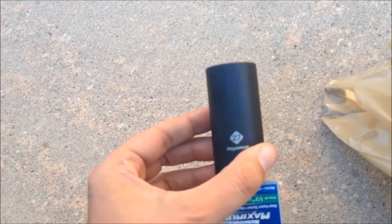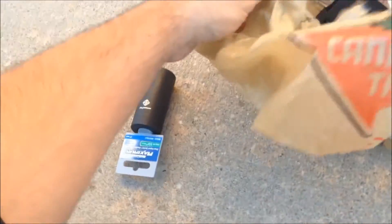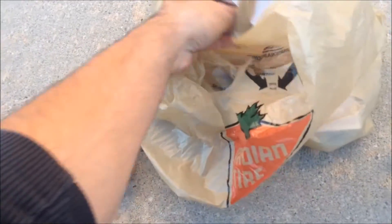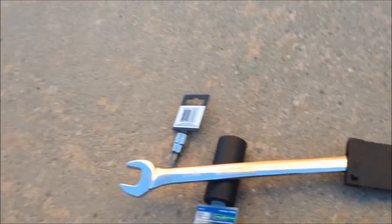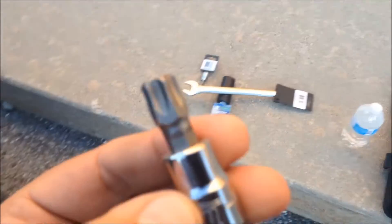So you need these tools for the job. This is a 27mm — this is for the big crank pulley. This is a 22mm — this one is for the sensor from the thermostat. This is a T45 — this is for the crank pulley to remove it, the bolt on one. And this is the T55 — this is for the belt tensioner. Alright guys, let's do it.